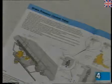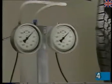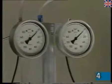The rear brakes are controlled by a new type of regulator. It regulates the rear brakes depending on vehicle load, brake pressure and any body roll as the vehicle corners. A detailed description of its operation is included in the self-study book. The regulator's adjustment procedure is quite involved and, of course, most important, so refer to the workshop literature for details.